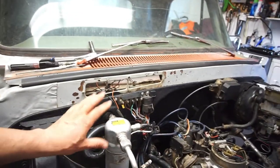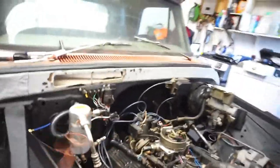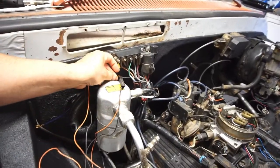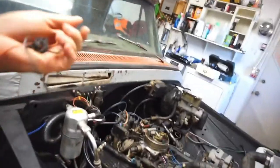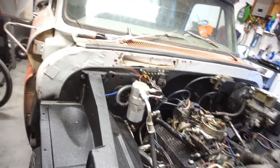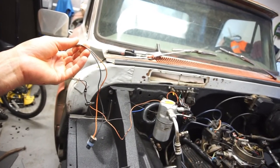I ended up removing the hood harness and the hood light, and just stuff like this — I don't really know what this is for. It's not for the windshield washer. I don't know what this wire is for because it's just a hot wire. The orange wire goes into the power and the black wire is just grounded, so it's just a hot wire harness, which means it would just be on all the time — more of a drain. I don't really know what it would be needed for.